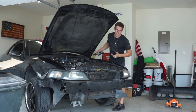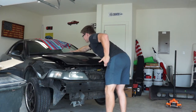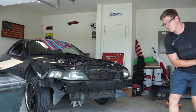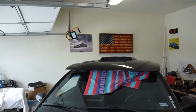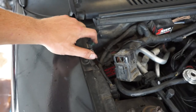This would be easier with two people, but there's only one of those people here. We'll do the just-in-case angle — how bad can it be? The garage door got in the way. If you're doing this, I do recommend the second person. Now we've got some angry roof scoop action going, like an old truck or something. We have the quick electrical disconnect right here — a 10 millimeter bolt goes down in there. You've got to disconnect all the ground stuff for the hood.